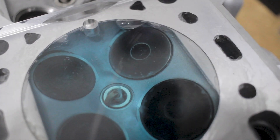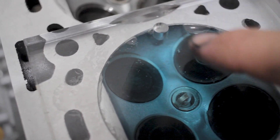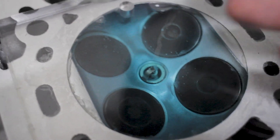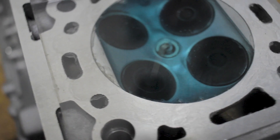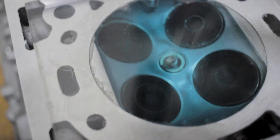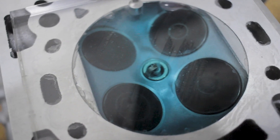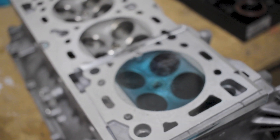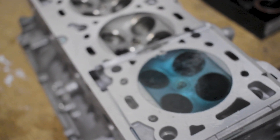We ended up using about 49cc of fluid — we're right at about 51 on the beaker, so we used about 49cc. I'm pretty happy with how things filled up. We did have just a little bit of spillage and a couple bubbles, but nothing is leaking out of the cylinder head, so we're getting a good reading. I did have to go around and do this a second time — I'd recommend doing it two or three times to get an average. Try number three is right at the same reading, so I'm happy with that average: 49cc combustion chambers.